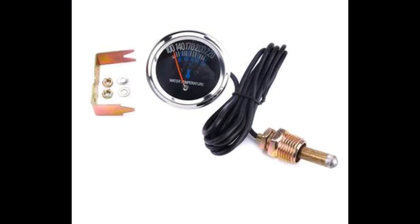The other type of gauge is a mechanical gauge. A mechanical gauge has a physical connection that comes out of the back. Most of you have probably seen these at the parts store — your Sun gauges or the cheaper Auto Meter ones. They have a tube or a line that comes out of the gauge, and you have to put a hole in your firewall and try to feed it through there. If it ever breaks on the water temperature ones, you've got to replace the whole thing. On an oil pressure one, they run a plastic or copper tube through there, and when they break and fail inside your vehicle, they spray oil all over your car. That's bad — another benefit to having electronic ones.